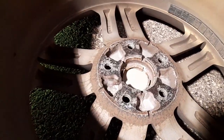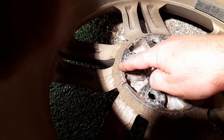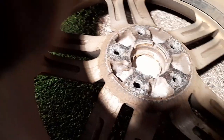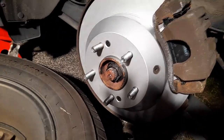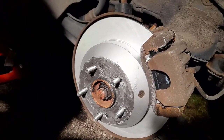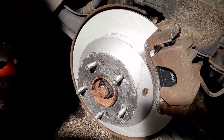Again make sure there are no bumps on the hub face — run your finger along it, yeah right there. Scrape with a screwdriver and put some grease on there too. Even though it's painted I put grease on there — it will never rust again, especially on the lip, because sometimes it rusts and won't come off.